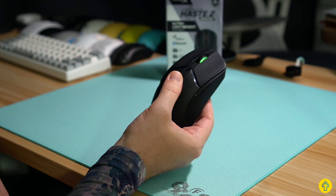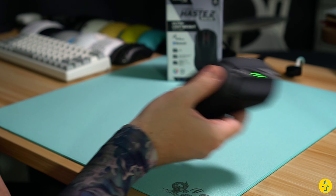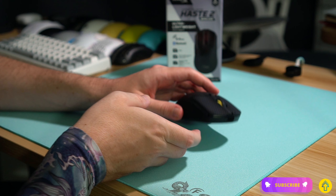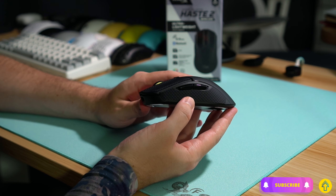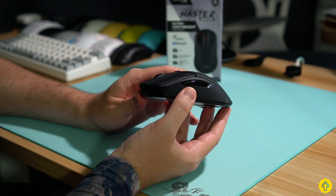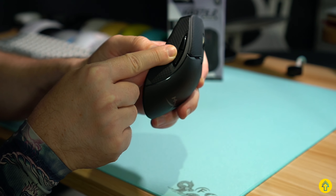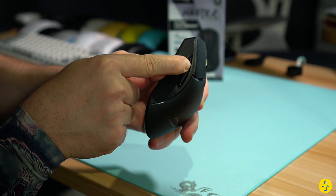Obviously you're not going to be doing this normally, but if you move your mouse or toss it in a bag or something like that, it can activate that DPI button. Other than that, there are the below-standard side buttons. The placement and sizing is actually pretty good, but they do have a lot of post-travel — really the most in any mouse I've tested recently. They kind of really dig into the shell itself. It's kind of hard to see with this glossy black plastic, but they really do give in quite a bit into the shell.